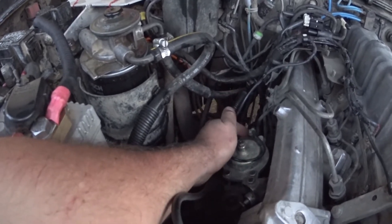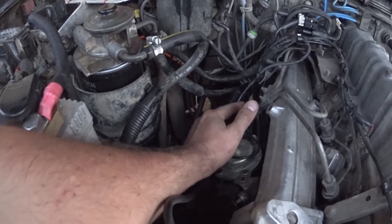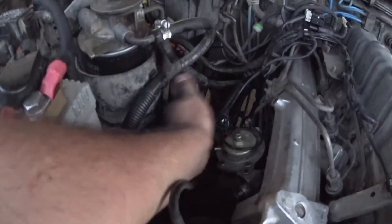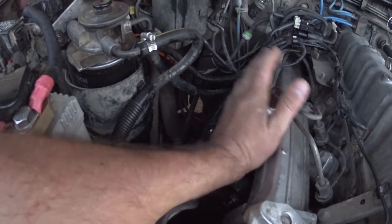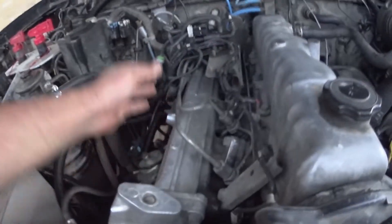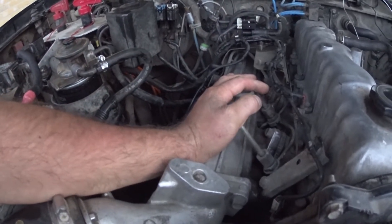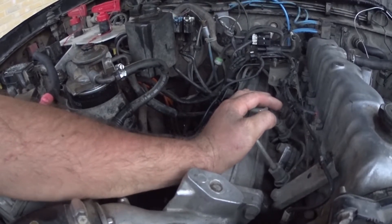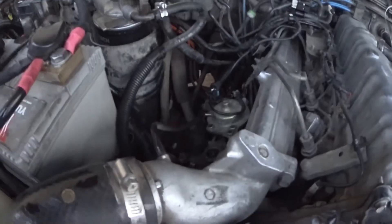Standard spec is 0.95 to 1.05. I've had good results on my old Mark Two engine — that was electronic — at 1.15 of lift and that went all right, it wasn't too clanky. Obviously your mileage may vary; see what sounds good, what gets good economy, and doesn't melt your pistons.